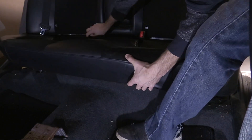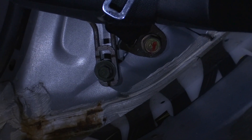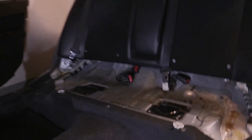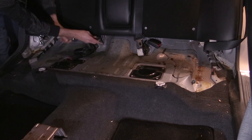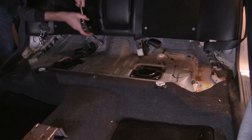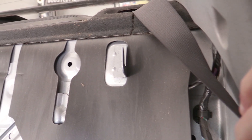Now for the upper portion of the rear seat — this can be one of the trickier parts. Removing it is pretty easy: there are three bolts holding it in place. I'll show the one on the passenger side, then the one on the driver's side. The actual third one is in the middle, kind of covered by the seatbelt plug-ins. As I remove the two outer bolts, I'll also show where the third bolt is. Once all three are removed, you'll want to pull the seat out a little from the bottom and then lift up, because there are hooks that hold it in place.